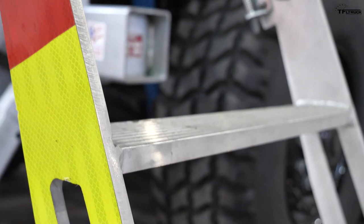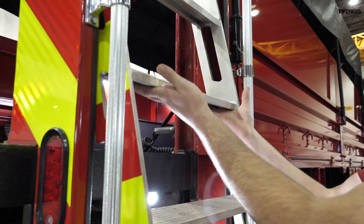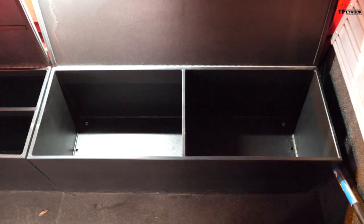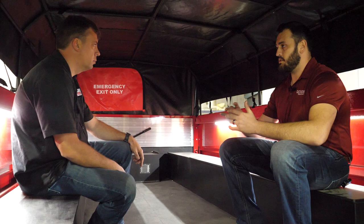There's lighting here, and these are storage boxes and seating. We take out the standard fold-up fold-down military cargo seating and reinstall it with a half-inch-thick polymer box, achieving multiple missions at one time — seating along with storage capacity.